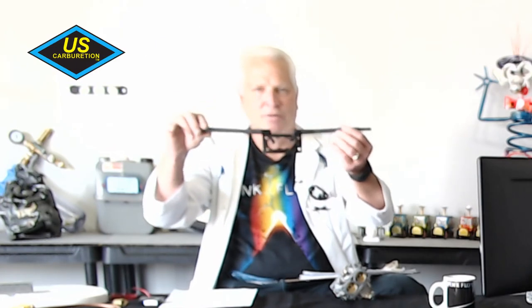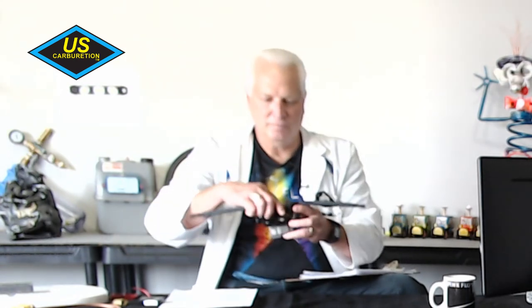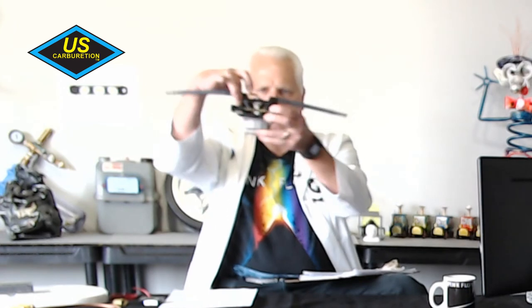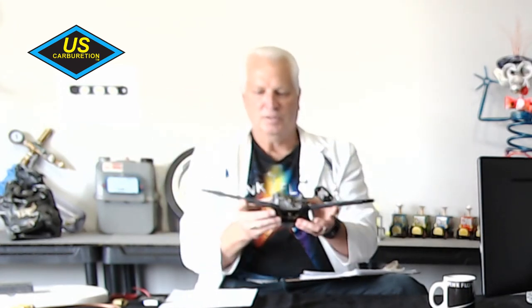Now, can you see? This is the two-barrel motor snorkel. This is what would go on a lot of the larger mowers, like my ZTR, which has the two-barrel Nikki carburetor. It just sits right in front of the choke plates. Put the air filter back on, and you're good to go. Two hoses to one engine regulator. Purrs like a kitten. All right. I keep saying that, a kitten.